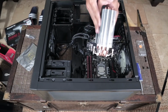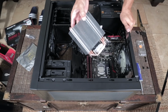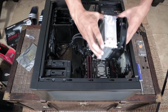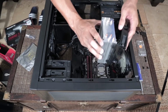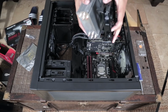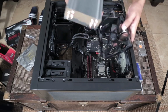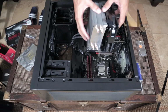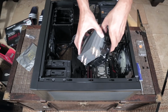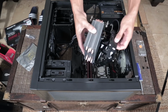Okay, here's the heatsink. I'm going to go ahead and screw this thing into the mount that we screwed in earlier. This is the fan that will be connected to that heatsink. I just want to make sure there are no spacing issues. Quick tip, these fans that come onto your CPU cooler, the heat sinks, they can actually typically either be installed on one side or the other side. I think for the most part they always come pre-installed, so the fan snaps on, like I just have it now. In order to get it off, you just lift these little clamps.